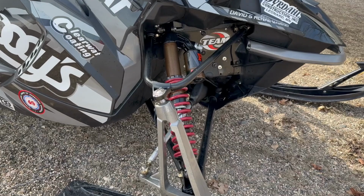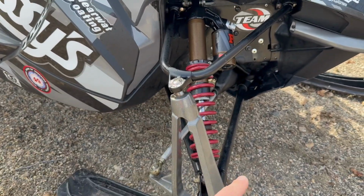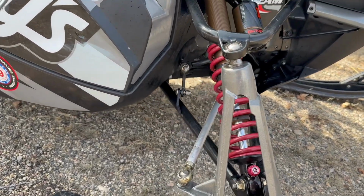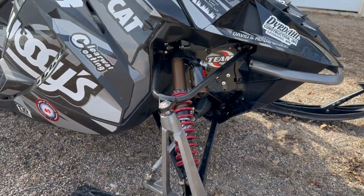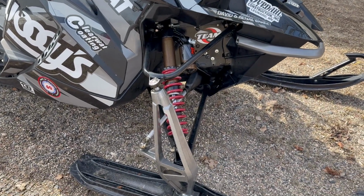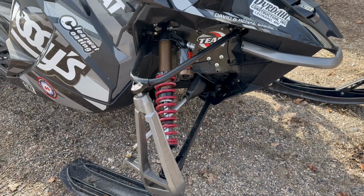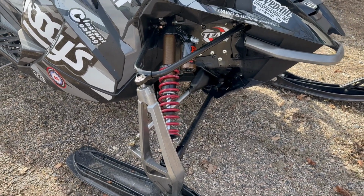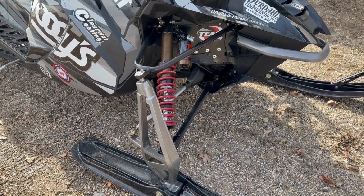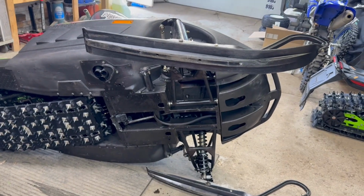And another thing we do with all the ball joints and everything, like in the linkage for the sway bar and A-arm mounts, we just give everything a little once-over of WD-40 just to put an oily film on it to keep it oiled over the summer. So that's another little tidbit we do. But yeah, here's a good video.